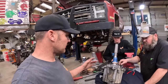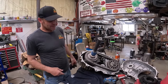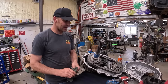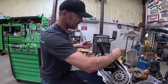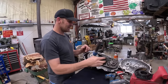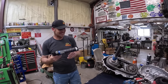I think we figured it out but we've run out of time today — Michelle says dinner's ready, Ben's got to go home, so we'll work on it tomorrow. It's morning again — we've slept on it and we're back. We figured the transfer case out — why it was having some shifting problems. Ben figured it out, sent me a schematic. We had two too many: a thrust washer and a roller bearing too many — we couldn't figure out why they were in there. Now we should be able to throw some silicone on this thing, slap it back together, and wait for our seals.